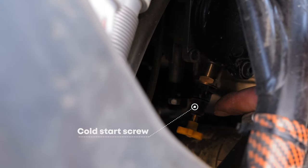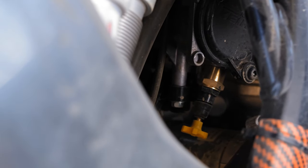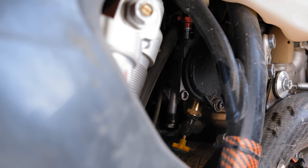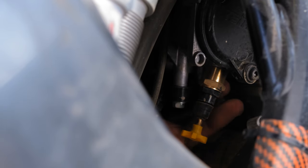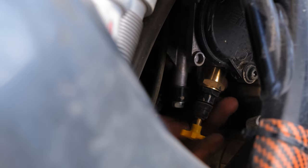This yellow screw down here is actually a cold start screw. If you press it up like that it works just like a choke, and if you pop the throttle quickly it'll kick it back. It's very much like a choke in that it's just for cold start. It has ranges of adjustment — it clicks just like a shock adjuster — and what I did initially to get the idle up was screw this in a whole bunch. What that does is kind of apply choke.